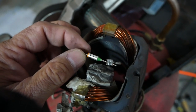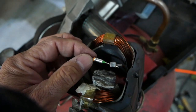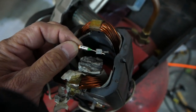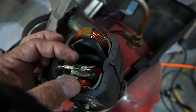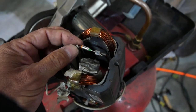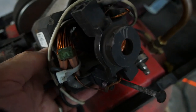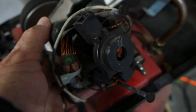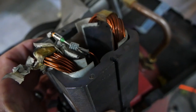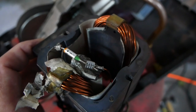It's nice to have them on hand because you can do a quick repair. As you can see, a quick repair had already been done — that's when I knew what the problem was, because the exact same thing happened years ago: the fan came loose, it kept running, it overheated and popped this fuse. I used a multimeter to trace down where the failure was. In the front there's also a regular fuse you should check first, but if the fan is missing, that thermal fuse is what popped.